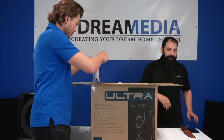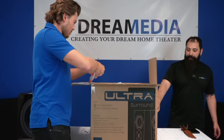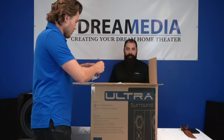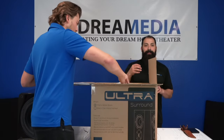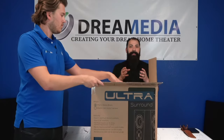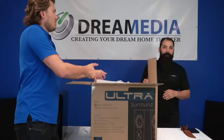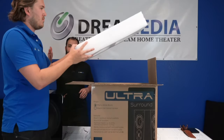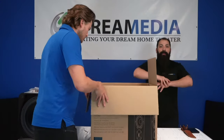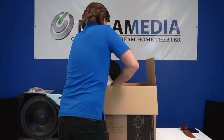Let me talk about some of the specs. You're going to get dual 5.5-inch mid-bass drivers and dual 1-inch aluminum dome tweeters. With that aluminum dome tweeter, it gives you a really diffused type of sound. A lot of popular speakers have a recessed tweeter that just blares it right at you, so you only have a sweet spot in a narrow area. With an aluminum dome tweeter, you get more diffuse sound, so anywhere you go in the room you're pretty much in the sweet spot.